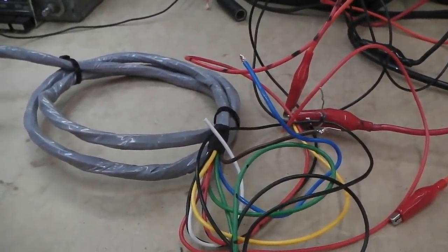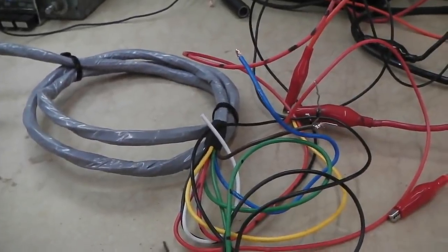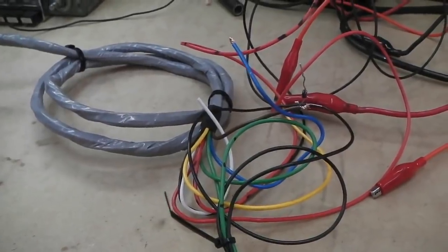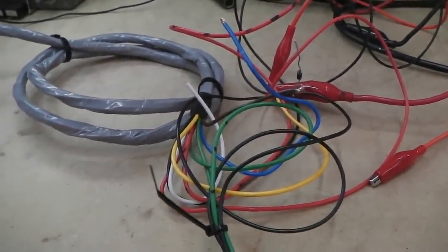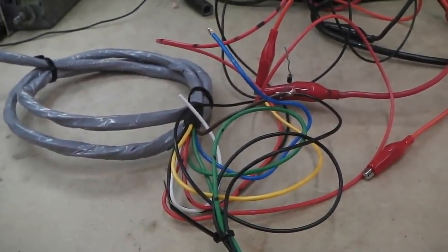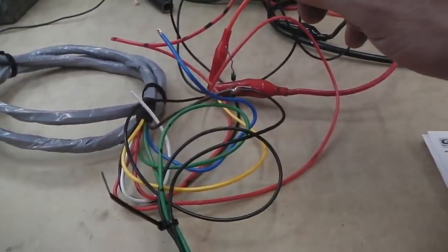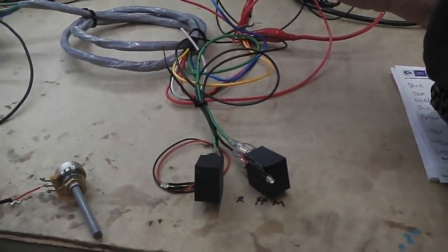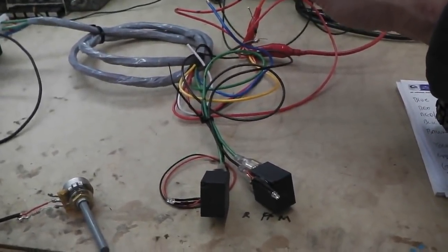That will put Rain-X on the screen, helping with the screen cleaning, and not only cleaning, but it also applies the Rain-X. It primes the rain sensor ready, gives it a good chance of having a clean sensor pad area, and then it'll do one cycle, and I won't be able to hold on the washer jet with my foot. Once you touch that, it's up to the computer what it does with the washer jets. You can't force extra water on.